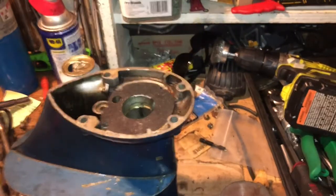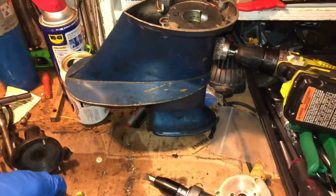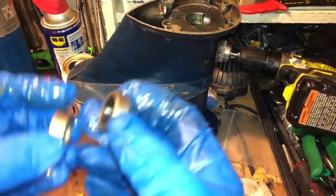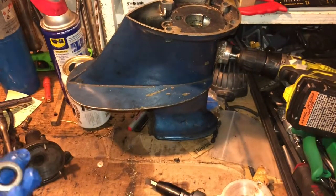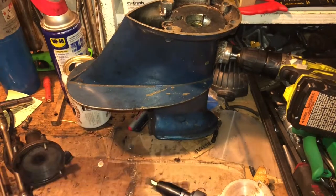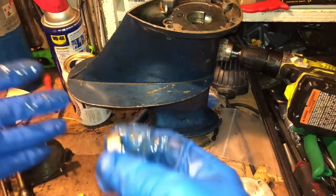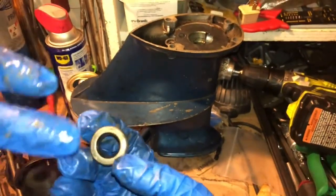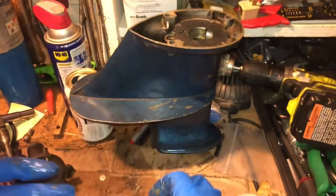Now I've got to put the seal into the plate — should have done that first. There are two seals that come with the kit and I believe they're the same. My gasket sealing compound is still viable. Some of the older seals don't have the spring — it's got a metal ring on the inside. Just know that the tapered side goes in towards the oil.